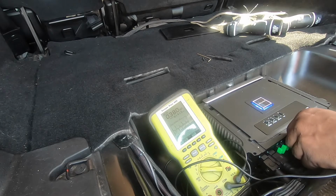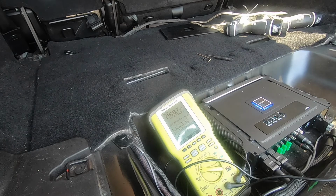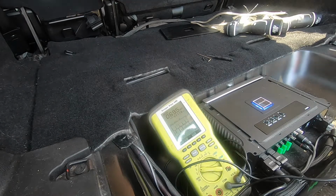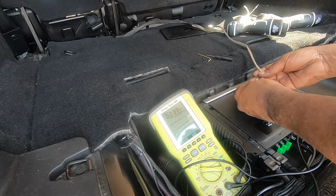So what we'll do is now, since we're in the back, we'll do a gain overlap on the sub. So the sub will be 40 hertz at, I like to do 10 dB on the output gains for the sub. So let's check that. So we have the level at negative 10 dB at 40 hertz, and let's check to see what the gain's set at right now.